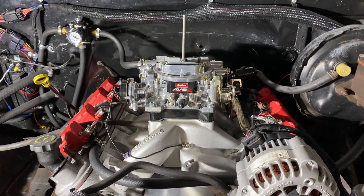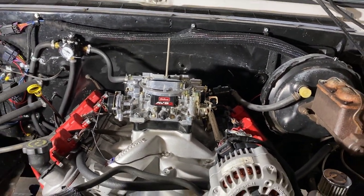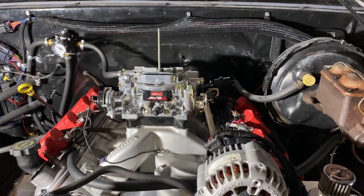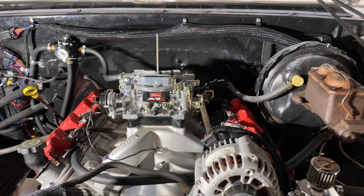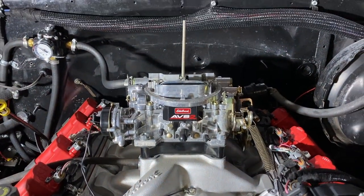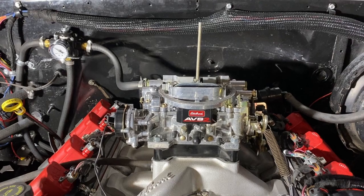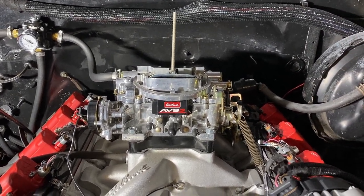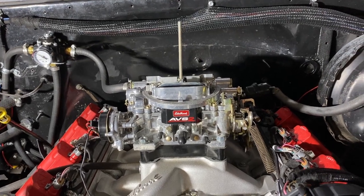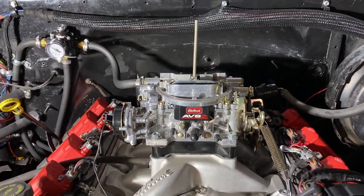I did some research — I went on Google and searched lean bog. The first forum I looked at told me to put some stiffer metering rod springs in it. I put some stiffer springs in there and that made a difference, but it was still doing it. A lot of people will show you tuning with a vacuum gauge, but if you have a way to determine if you're lean or rich, it's easy — look at your exhaust pipes. If there's not a lot of soot and it's pretty dry, you're definitely very lean. If it's really rich with a lot of black powder around your exhaust, you're extremely rich. Going off of that, I said I'm lean.